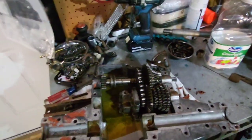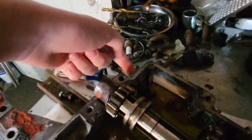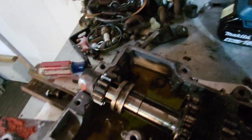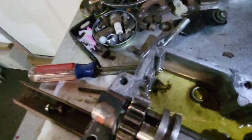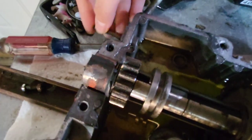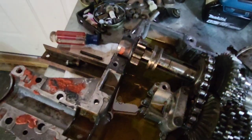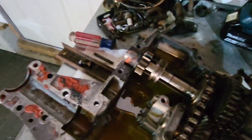The four bolts that go in the front — I had them just sitting in there because I didn't want to lose them. Apparently this top one, I don't know if you can see, that top motor bolt pushed right through that hole — it goes right through. So that's got to get TIG welded up because when I went to go put it in, it just started puking out all of its oil. You can see there's that little chunk of aluminum that pushed through. That was unfortunate.